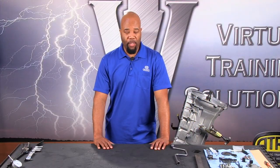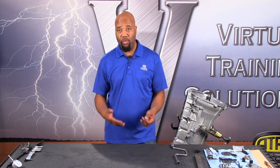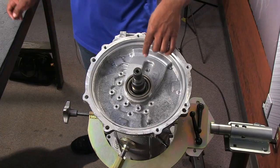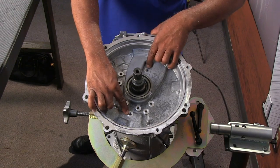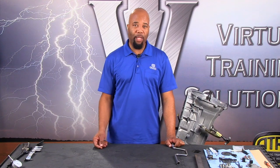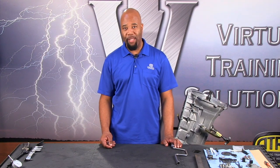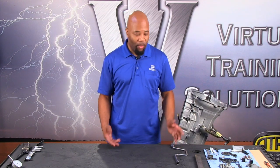When removing the pump cover, there are a couple of ways to do this. General Motors shows you in the manual to use two slide hammers. There are threaded holes that allow you to screw a three-eighths thread slide hammer in and slide hammer this assembly out. It's a little rough — there's a very thick O-ring to overcome, and if this transmission has been in the vehicle for an extended period of time, it's not going to cooperate with you. So we did find another method that is very useful and helpful.